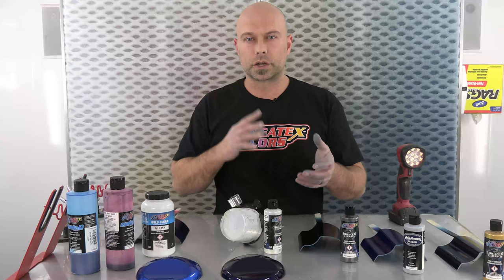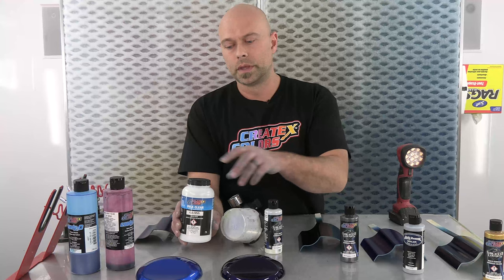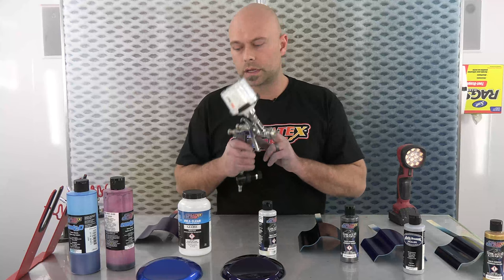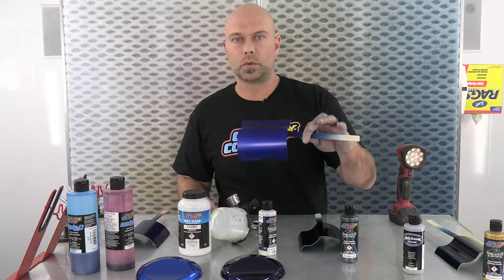I'm going to mix it up like I usually do because it's a pearl color. I like mixing it right around 25% of the 4050 in with my paint — about 4 to 1 or 3 to 1, depending on what you're doing. That seems to be a good ratio. The 20 to 25% really helps the sprayability and elevates that pearl effect. I've got the gun ready and I'm going to put a couple coats over this blue here, over the silver sealer, so we can really compare what that does versus the neat clean one over silver sealer.